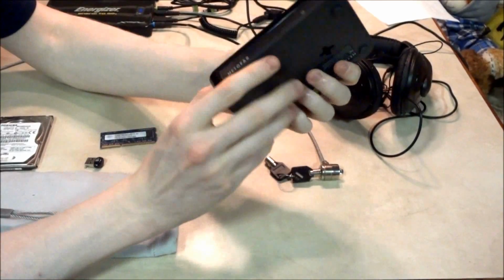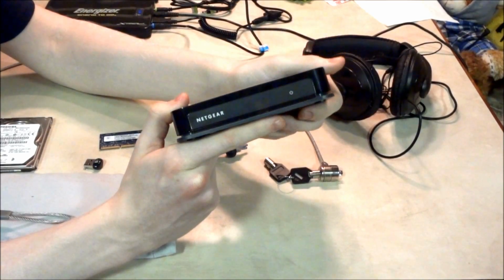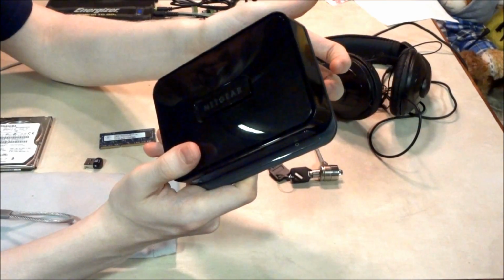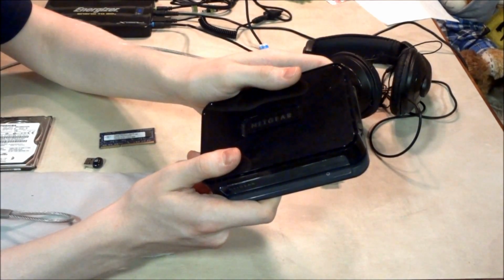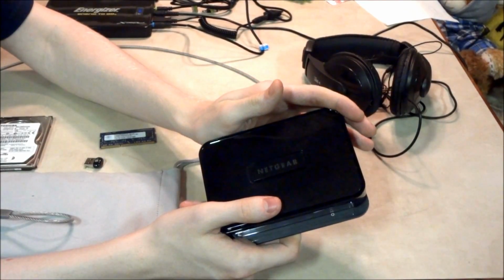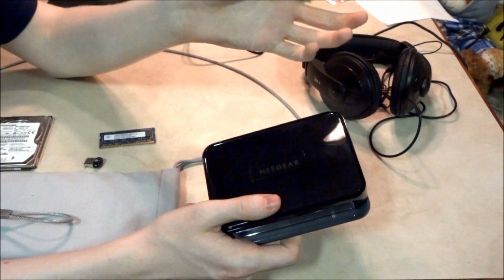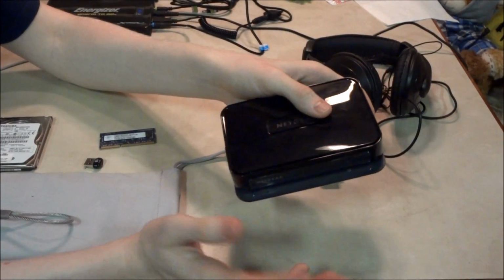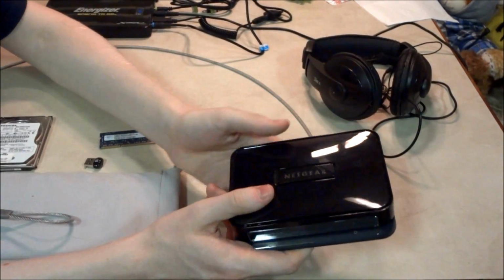move on to this. Now, a couple of years ago, a new technology from Intel came out, and it was called wireless display, or WIDI. And what you needed, it first started out with the Blue Label laptops that Best Buy sold. It started with the E205 that Toshiba came out with a couple of years ago. And what it does, it incorporates an Intel Core i family series processor, which is your Core i3, i5, i7 series processors with the Intel onboard graphics. And at the time they were using that, it was the 4500 MHD, I believe. Of course, they've got much newer versions now.